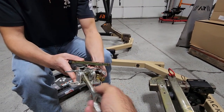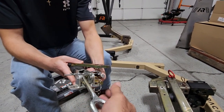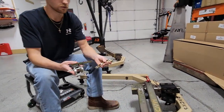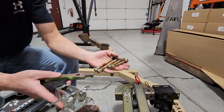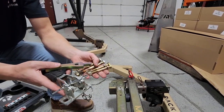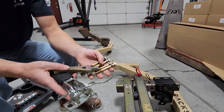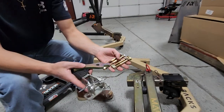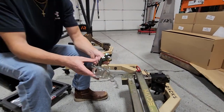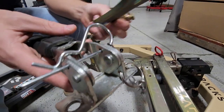You're gonna get the latch body and then we're gonna take this head off — there are a lot of turns here. You're gonna get a 3/8 by 4-inch bolt with one washer and one nylock, and then you're gonna get two 3/8 by 3-inch bolts with two washers and two nylocks. The 4-inch bolts are gonna be for your latch; the 3-inch bolts are gonna be for the latch plate.